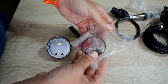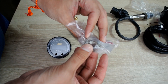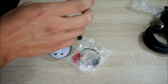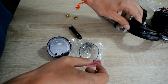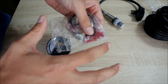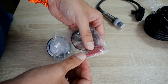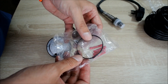Last but not least is this little plastic bag. Inside is a bung — this is the bung that you are going to weld onto your exhaust manifold, and you then screw the sensor inside the bung. We also have some butt connectors, used for the little electrical connections. Interestingly, I actually have a video of a wiring harness restoration where I used butt connectors and a lot of people gave me grief for it. I think if AEM thinks butt connectors are good enough, you should too.